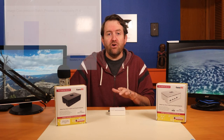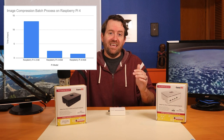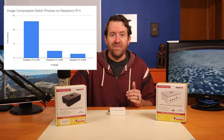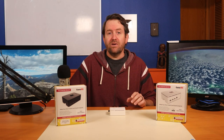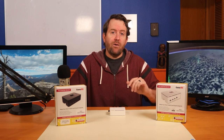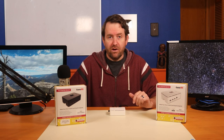the process took over 13 hours on a Pi 4 with 2 gigs of RAM. That same process came down to 2.5 hours with the 4 gig version, and then less than an hour and a half with the 8 gig version. It's not a realistic everyday use case, but it illustrates just how effective writing to memory is versus having to rely on physical storage.